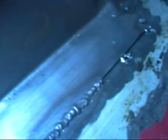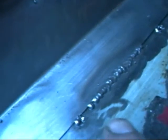Okay, there's the plate with the first spot welds in. After those few spot welds are done, I then tap it so it's closer to the floor all the way around. And also hold it down with the screwdriver while you're putting the spots on. At this point now, I've got the thing welded in. Sorry to say, I still haven't used my welding mask yet, but I will tell you I wear glasses, in case of any accidental flashes with your eyes. There's a bit there fully seamed in. Now it all needs to be done like that, but staggered all round the joint until it's all filled in.